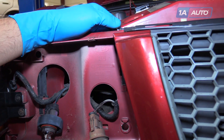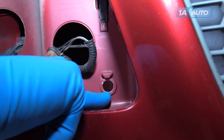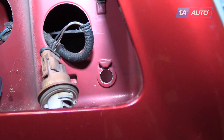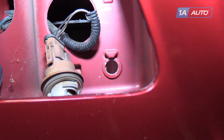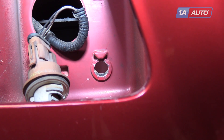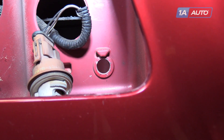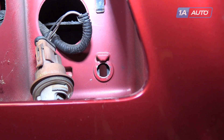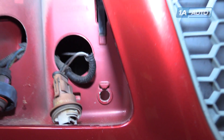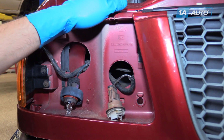To give you a better idea of how these headlight retainers work, you'll see the hole here where our plastic retainer is going to slide in on the back of the headlight. This is with that slide in the floating position. If you pull too far up, the metal comes through the opening and will still hold the bottom of the retainer — it's a keyhole. When you slide down, that thinner portion locks over the top. So when we hit this nice middle point is when our headlight comes out nice and smooth.